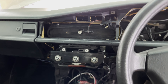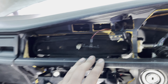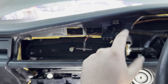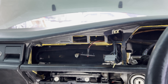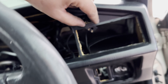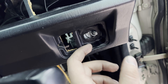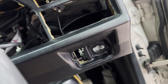The vent surround is out. I lied — there are actually four bolts: two at the bottom, one up in the corner, and another one behind the switch. Be careful, don't rush — take these out slowly and be really careful because they will crack if you're not. I took the front panel off: there's a big nut you remove, then you pop the switch backwards and take the panel out. The rest can just hang in there — they're not going to be in the way.